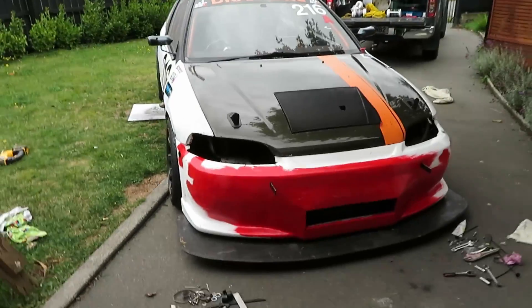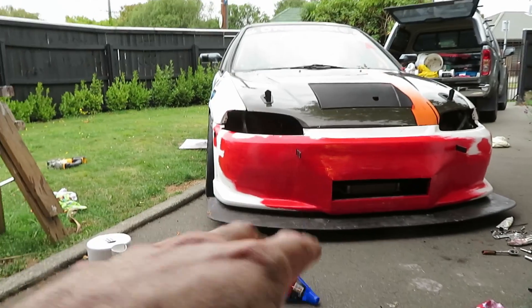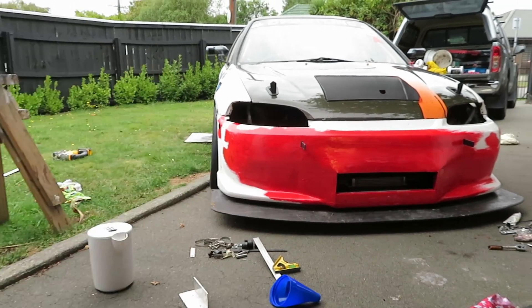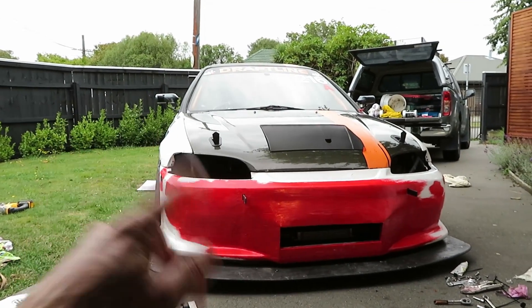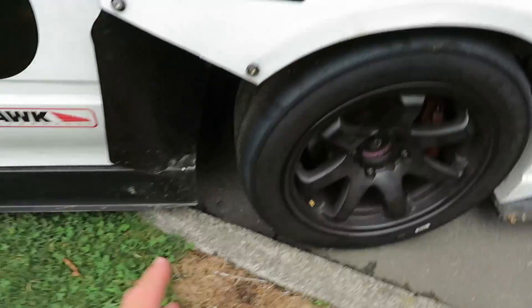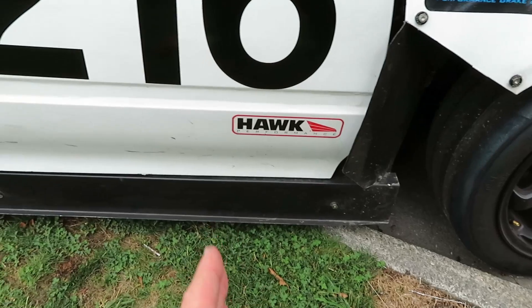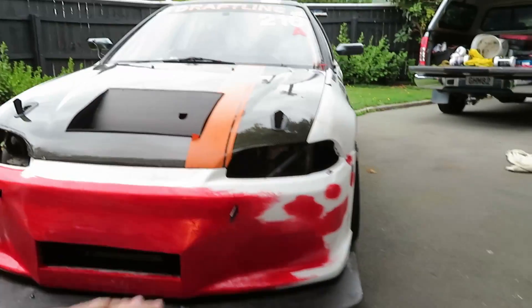That's it as a package — this is the dream and it's almost there. I'm going to remake the front splitter out of foam core with either carbon or fiberglass — carbon might be a bit expensive. I want to make it go back under the car a bit further than it does now. Currently it ends just behind the engine; I want to bring it further back and attach it to the floor of the car with some slots and brackets. Right now at high speed down the front straight, the splitter is only attached at two points on the front chassis rails and the back is flapping.